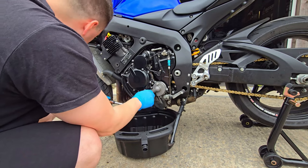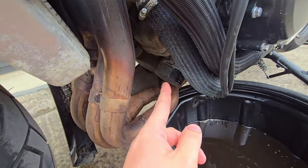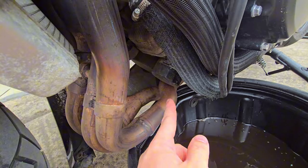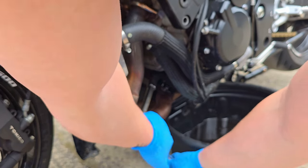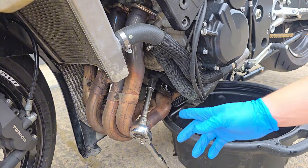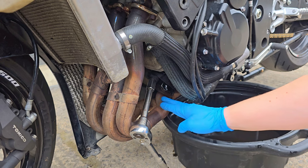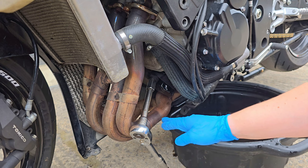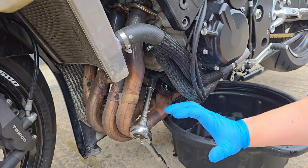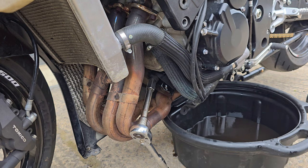We'll leave this draining and move over to where the oil filter is located — just to the left slightly, between the manifold. Grab an oil filter tool if it's on tight. Remove the filter by turning it anti-clockwise. Just bear in mind more oil will fall out of the engine and the filter when you remove it — it's going to drip onto the manifold, which you can clean off with brake and clutch cleaner. Normally I'd put tinfoil over the manifold to catch the oil drips, but I haven't got any today. That's the old oil filter off — part number HF138, but I've got a K&N to replace it.